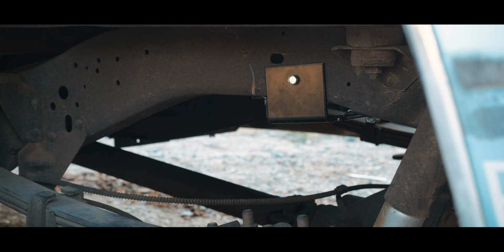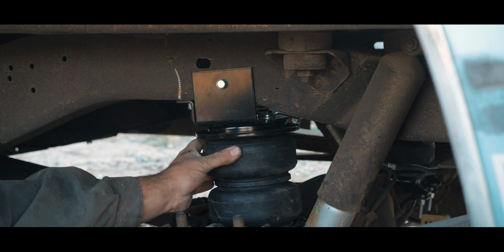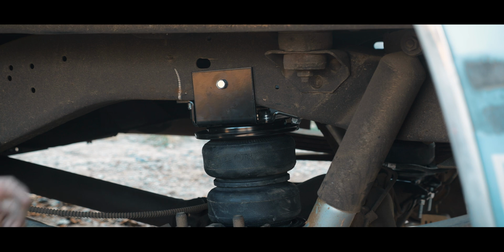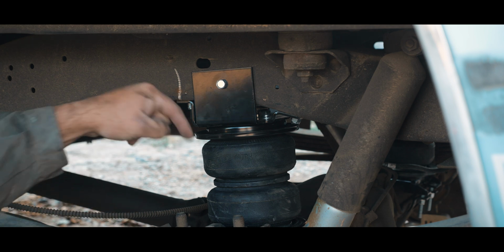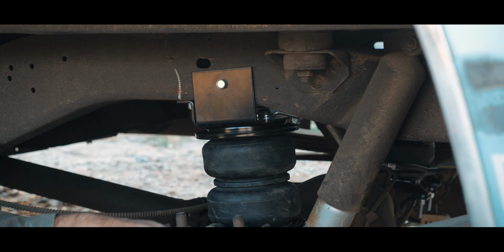This is going to be frustrating and I don't want to cuss too much on my channel, so I'm going to loosely attach this. I found it is actually easier this way. I'm going to attach this while the bracket is attached to the truck and tight, and that will make it a little bit easier on me. So I'm going to do that, and I'll be right back. Okay, now, this is loosely attached. And the reason it's loosely attached and not firmly attached is because the bottom bracket still needs the adjustability to kind of sit on the axle properly.